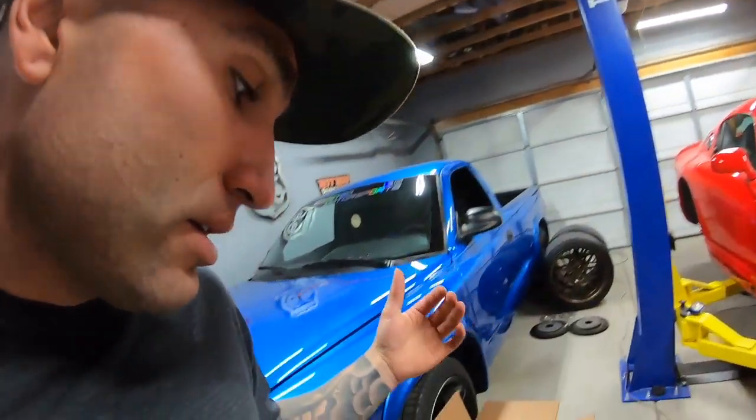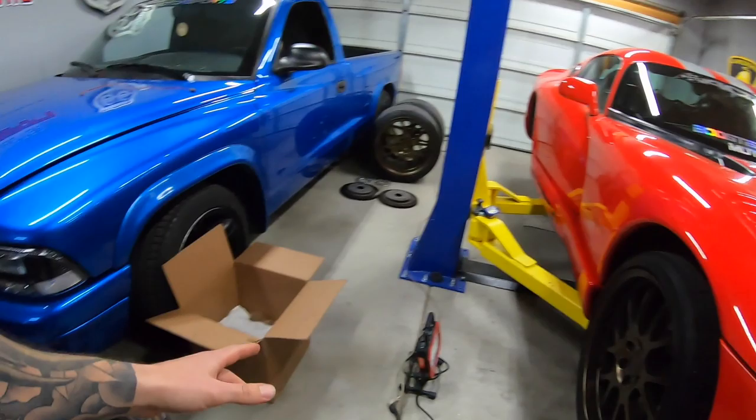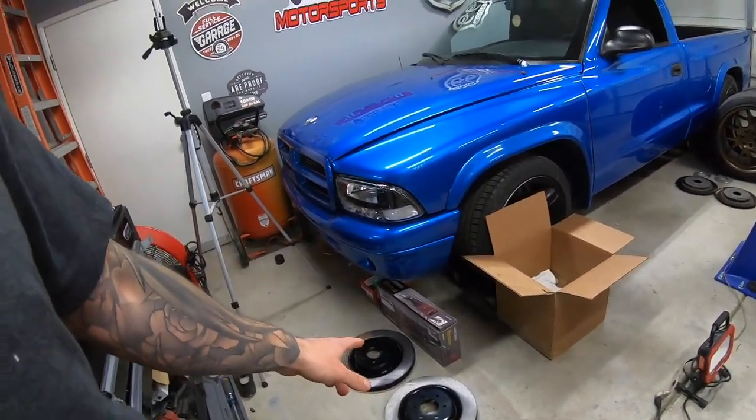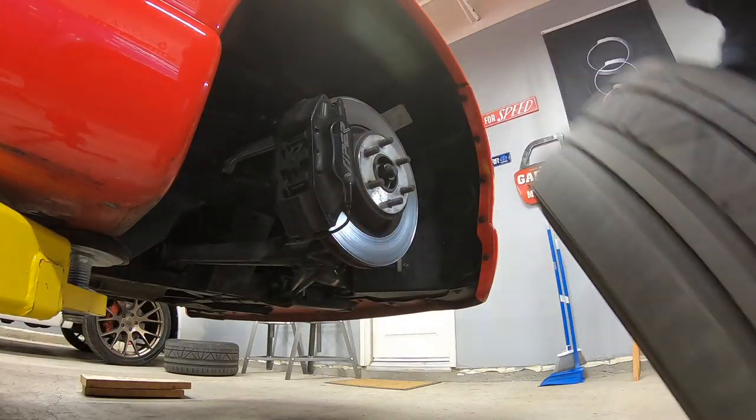We have two brand new 14-inch rotors — we're going to be using 14-inch rotors all the way around on this car. You'll need four front rotors for this application of putting the SRT brakes on all four corners. I'll link those in the description. If you're interested, IPSCO also offers kits where you can utilize your Brembos on the rear if you don't want to buy four calipers. Check the IPSCO link below for all the different conversion kit options.